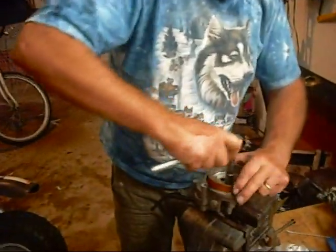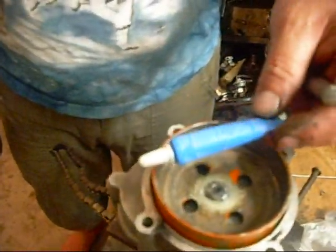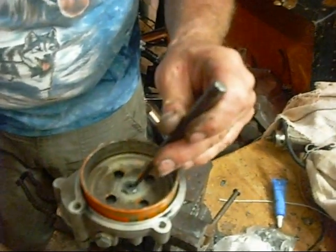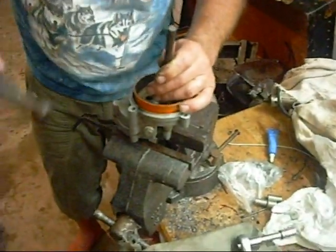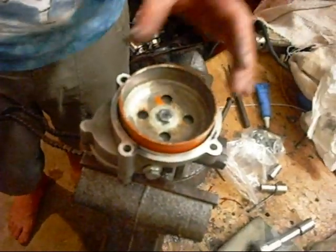We'll get this as tight as we can with a socket to secure it. We put the sprocket on the other side of the gearbox in a vise and protected the teeth with an old chain around them. We put Loctite on there, which is a thread sealant that locks the nut onto the thread. As another safety precaution, we center punch peen it — get a center punch and put it between the nut and the shaft and give it a blow. It burrs the end of the shaft and the nut over, which locates it and distorts the thread just enough to prevent it coming off.